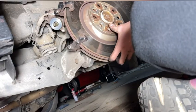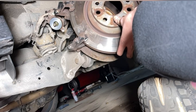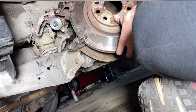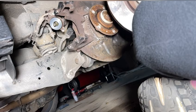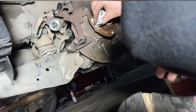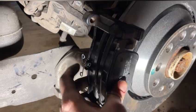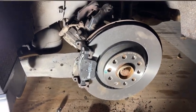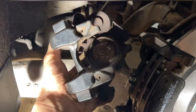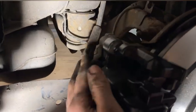A lot of people are saying you have to remove all this housing - you don't. The disc will actually just about come off. I'm going to give it a couple of taps around the hub just to free the disc. Really just smear the copper grease on. Test fitted and happy that these pads fit on the caliper. Now I've just slid the motor back into place, I'm going to tighten that up, and then effectively work backwards to assemble the brake system and wheel hub. I've refit the motor and the cable, copper greased up the piston, and now I'm going to slide this back on top of the pads into the housing.